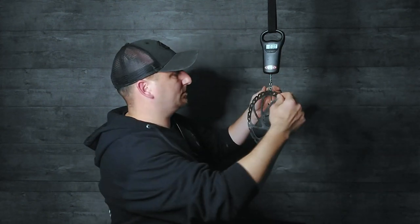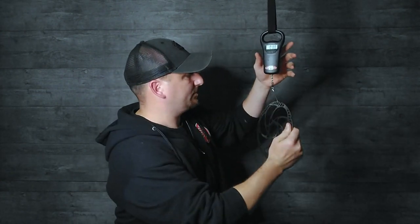With the added thickness, are we paying a weight penalty? Let's get these on the scale and see if the Magura 203mm rotor stacks up to the standard Hayes offering. I've got one Magura 203mm rotor and one Hayes 203mm rotor. First up, Hayes — settling in at 200 grams. Remember, that's 1.8mm. Magura settled at 170 grams. So we have a thicker rotor coming in lighter than one of its main competitors. Not too shabby.